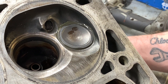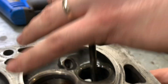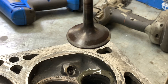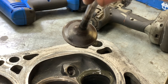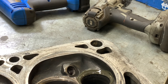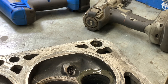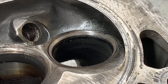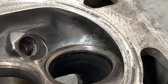What I do is just take the valve and go in and out with it so you can see it pulling more compound back in on the face. We can see here there is some pitting on the valve, but that's probably from the DOD lifters being collapsed and probably not opening or closing all the way - a little bit of corrosion. The inside of the engine is spotless, so I'm not sure what's causing that, but I'm going to go ahead and lap it some more. The seat itself looks fine - really nice and even, nice gray contact pattern - so we know the valve seat isn't warped.